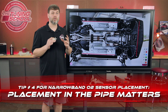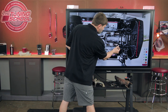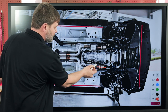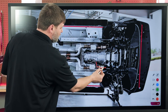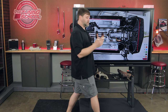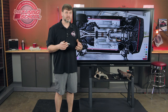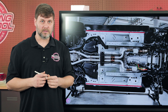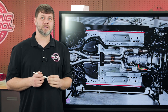Tip four: proper narrowband placement in the exhaust pipe. I recommend a 90 or 45 degree angle. We have an image here from a Corvette — the exhaust comes from the primaries and runs to your O2s. In this setup the narrowband is placed at a 90 degree angle, and a 45 degree angle will also work. What you don't want is your sensor pointing straight down, because you're going to collect moisture from condensation as your exhaust heats up. That moisture runs down the pipe to the lowest point and will get into the sensor and kill it. Also, if you weld a bung in your exhaust for your narrowbands, be sure the head of the sensor protrudes enough into the exhaust pipe that you get an adequate reading.